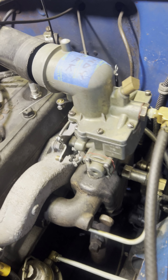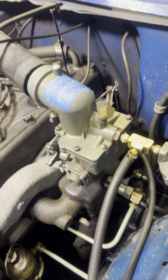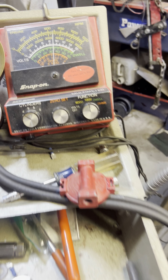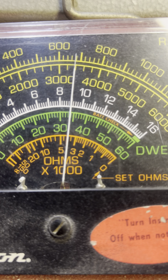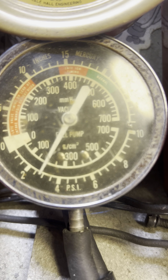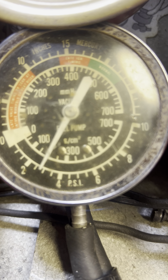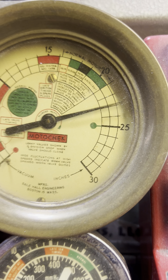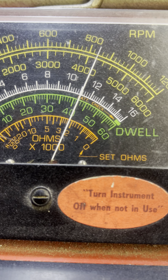Hey Randy. Here she is — happily got it in the way. I had to make some changes to it, this is what we got now. Idle RPM about 680. Fuel pressure I'm showing about 2.75. Vacuum 23. Dwell at 42.